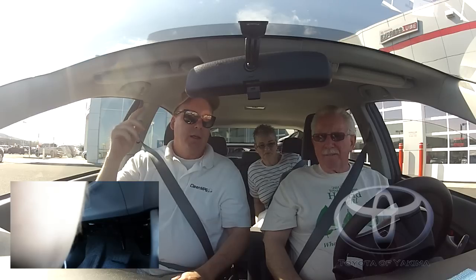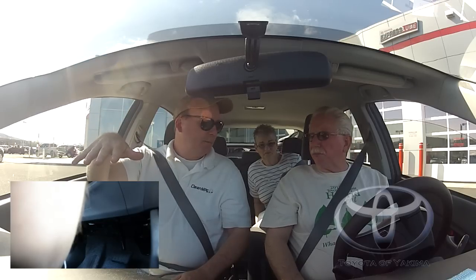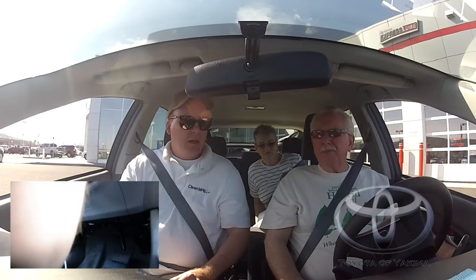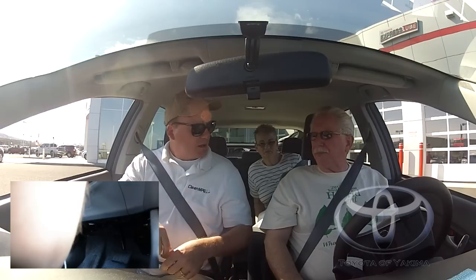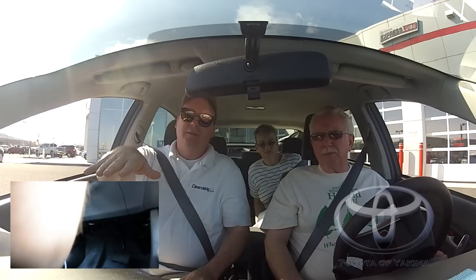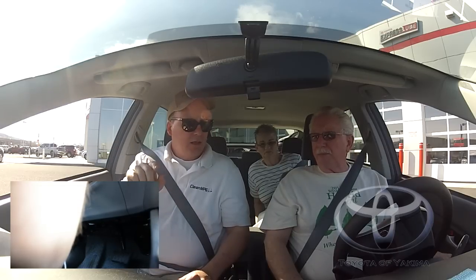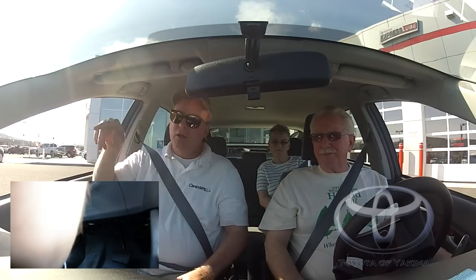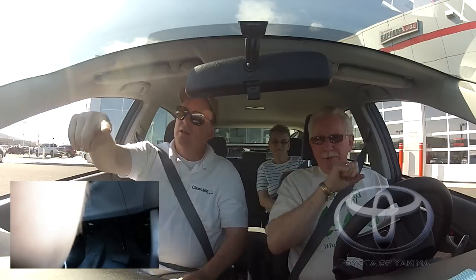Now, if you have a downhill out of your driveway, you know how when you push the power button, you can open all the windows and cool everybody off. You know when you hit that power button, about 4 seconds later the engine starts, first thing in the morning when it's cold? If you have a downhill, what you can do is you can hit the power button, go to ready, go to drive to get yourself moving and go right to neutral. Neutral, yeah. If you go to neutral, that engine won't start. And it's just enough to get you going down. Yeah. And then, in this case, like let's say you were parked here, you just get enough to get moving and get in neutral and coast all the way to there.